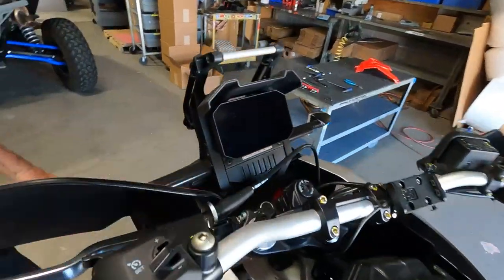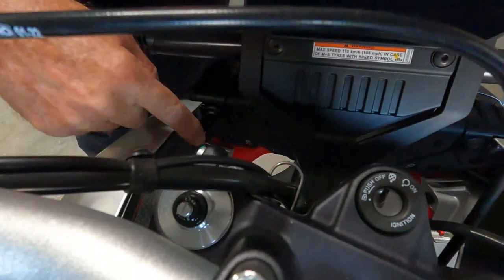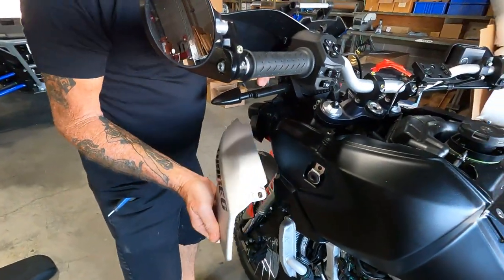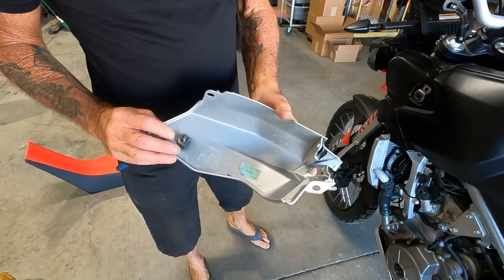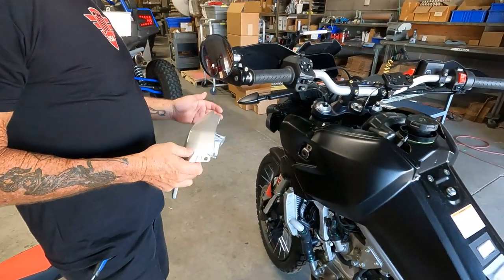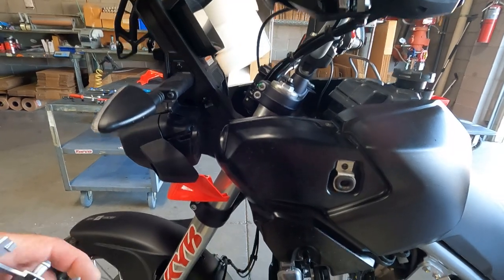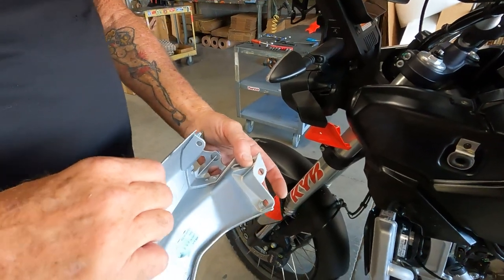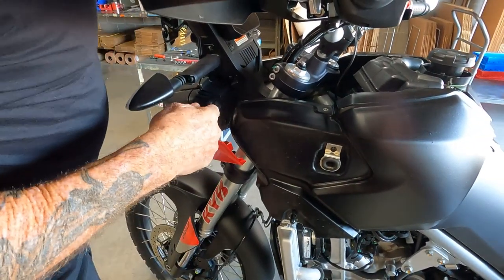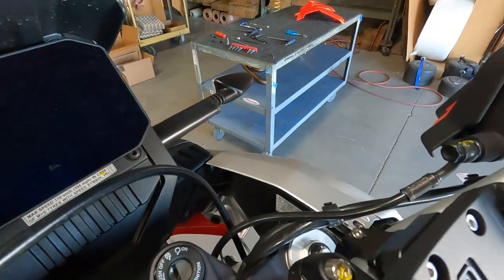This is one of the harder parts to take off only because you won't be able to find where the plugs are. It's got one plastic rivet right here and another one right there. It also has a connector in the front and a connector in the back — the rivets go through these holes. There's a tab that mates with this piece here, so when putting it back together make sure you line up these two pieces.